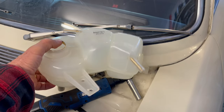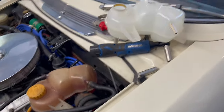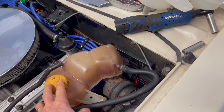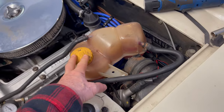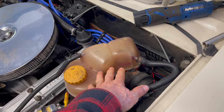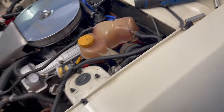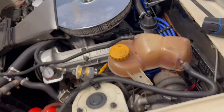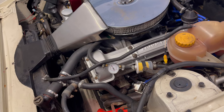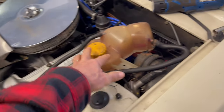As you can see, you'll be able to easily see the water level. There's an arrow marking the level it should be at so you don't forget. Lots of room for expansion. Initially I thought it was a little odd that the cap is lower than the top of the tank, but it makes sense because you always want to have some air in the tank to allow for water expansion and for the pressure to be fairly constant as the air is slightly compressed when the engine heats up. Otherwise it goes right up to the pressure limit of the cap and ultimately has to blow out of the cap.